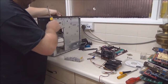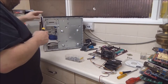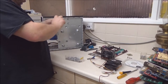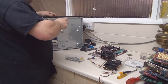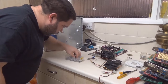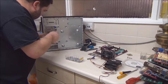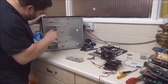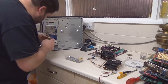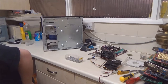I've got the screws in this side. I'm only going to put one in the other side — otherwise you push on there and it'll bow inwards on one side, so it just holds things a bit more secure. You can put two in if you want — it's just extra screws to take out should you upgrade or have to change hardware because it's failed. I'm going to put one in the floppy disk drive and one more in the hard drive. Drive-wise, we are done.